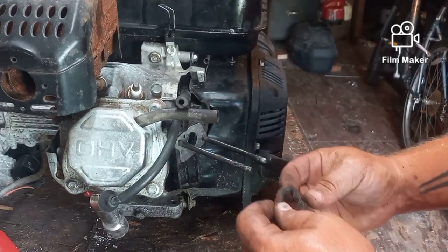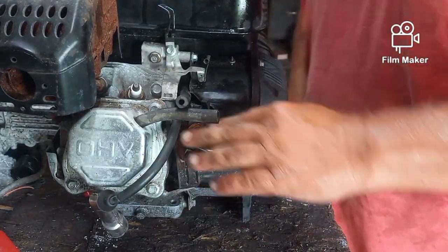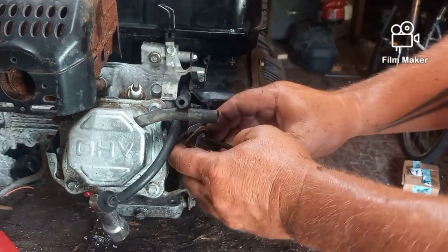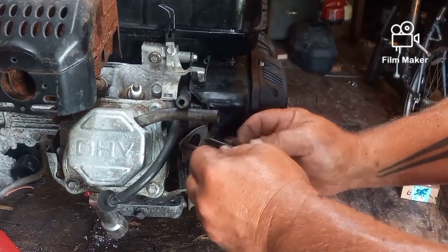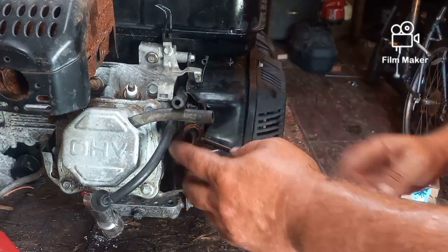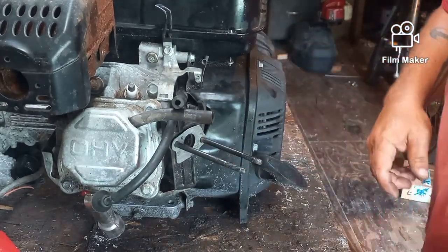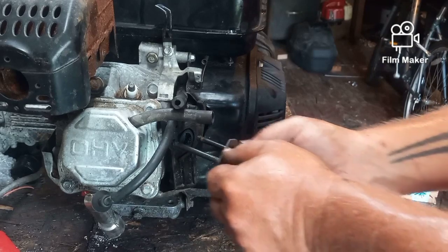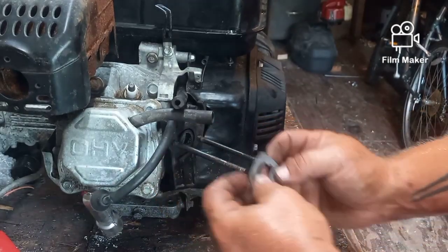It just doesn't look 100% right. So when something doesn't look right, go with your, no, that's leaving a space. That's not good. You can't have air being sucked in behind it, so I can't put it on that way. Okay. I'm half tempted to leave that slug out of there. Yeah, it's not going back against this manifold, this plastic sleeve here. It's not going back completely, so I think I'm going to leave it off. You'd think maybe they would send some directions with these, but they never do. You just kind of got to figure out the gaskets yourself.